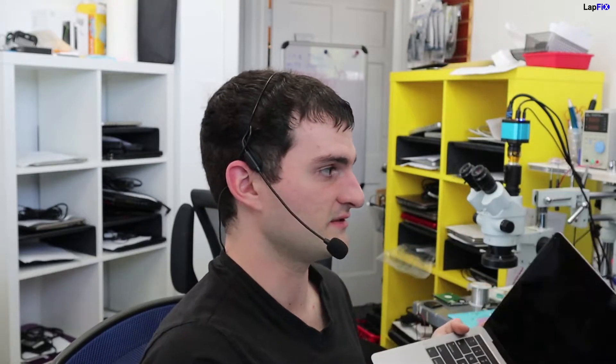The only problem is there's always a risk, because nothing is totally foolproof in any repair. For this one, we don't want the ultrasonic to clean everything, so we need to remove the screen and possibly the battery — it's attached right here. Maybe we can just dip it on one side. The battery is glued and the trackpad is in place, so we just want to get this keyboard area. There's also a possibility we could damage the touch bar, which is glued to the top palm rest. Let's open it up and take a look.